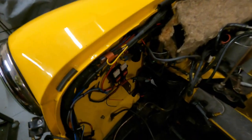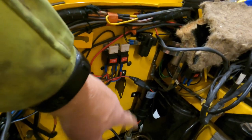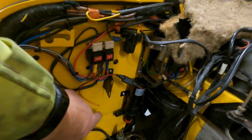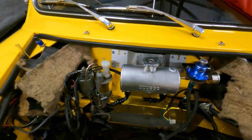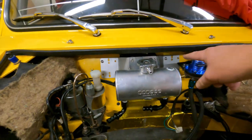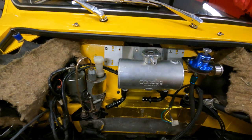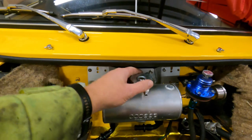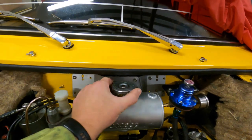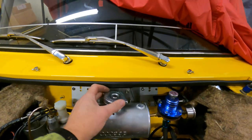It's been a time of hitting lots of bits of aluminium with a big hammer in the vice and bits of wood to make various shapes. I've mounted the water pump for the charge cooling system down there — put some rivnuts in and that's all in place. Hopefully I should have enough room. I've also done this bracket for the water reservoir for the charge cooling system — it's two bits of leftover aluminium, bent and shaped. It holds it quite well and there's just enough room to get the cap off, clear of the lip at the back of the engine bay.